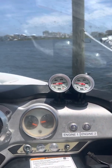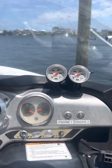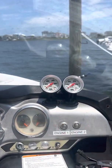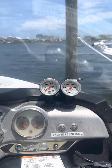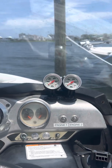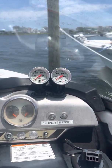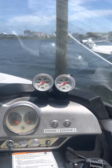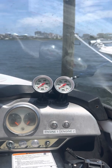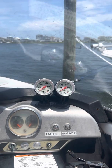The reason why I decided to install those gauges is because, like I said, between 3,000 and 4,000 RPM I get a low oil pressure warning on this port side motor, and I actually wanted to see what that motor is doing during acceleration and deceleration. I'll be candid — I think there's something wrong with the oil pump, because that oil pressure will drop between 10 and 13–14 PSI coming out of acceleration or decelerating. It only comes up for a second.